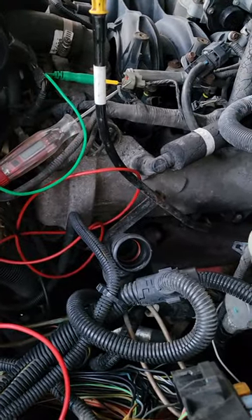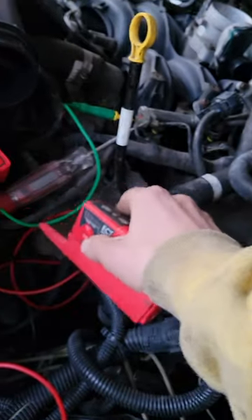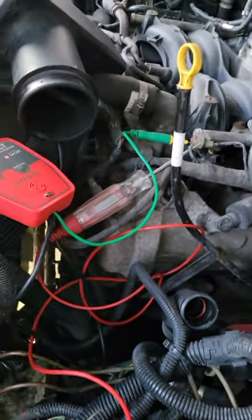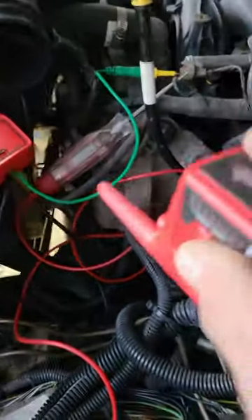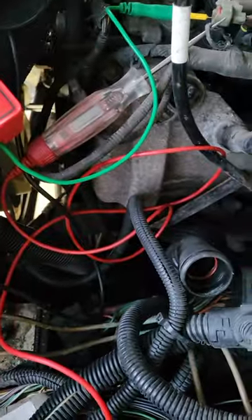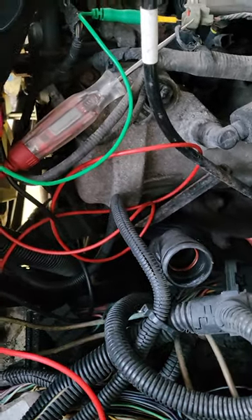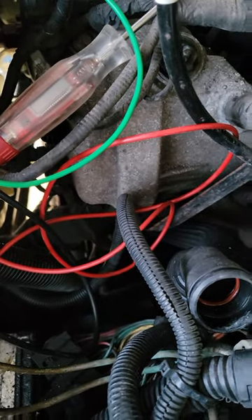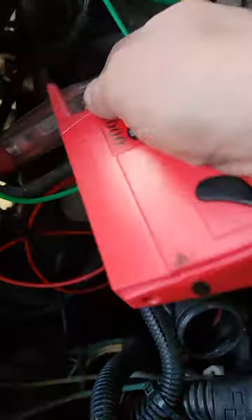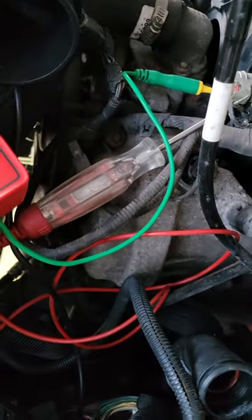Make sure your key's off. You don't want to send power through here and confuse anything — you just want the signal to travel through your wires. Put the black on the negative, the red on the positive. Take the green wire and probe whatever you suspect has the short — whether it's a headlight, taillight, injectors, coils, whatever it is. I knew I was losing power at my voltage wire for the injectors, so that's what I'm probing. I knew that by using a test light.